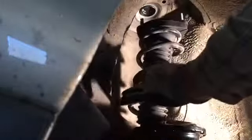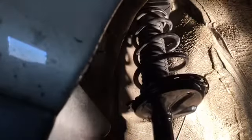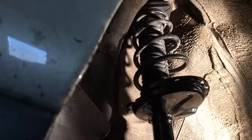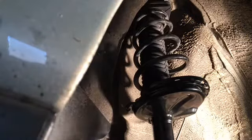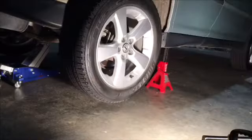We just position it back where it were and tighten down the 14mm nuts that hold it up top inside of the fender well. Put the two 19mm bolts in down below, and the other 14 and 10mm bolts as well. Okay, so there you go. I recorded one, do this times 4, and you'll be finished.